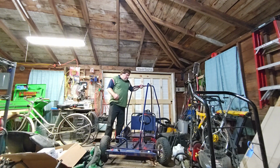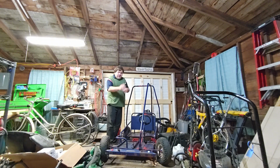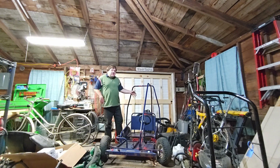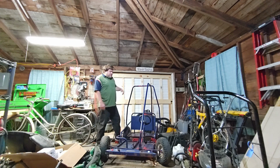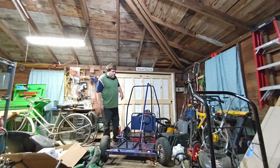I would definitely keep that if possible, and then just remove this one here and probably kind of look the other way on the roll cage, or if it wouldn't cost too much, redo the roll cage on this maybe, but probably wouldn't. Over here on the one side where the motor goes, I noticed there's one metal bar like this missing where somebody chopped that off, probably because they put a certain size motor on it, realized it didn't fit, so they modified the frame a little bit, so they already weakened the frame. So that's one thing we'd have to be careful of when cutting this frame up and extending it. You can run the risk of weakening the frame, and you have to make sure to add proper supports when at a welding shop. But a good welding shop will know how to do all that.